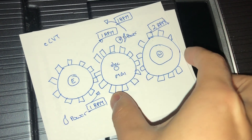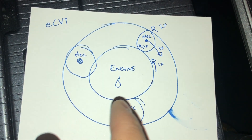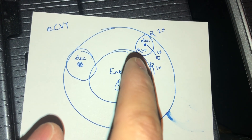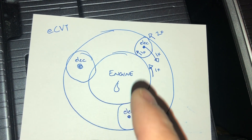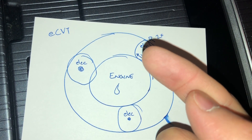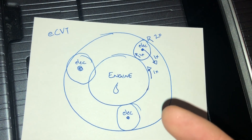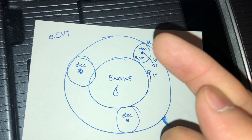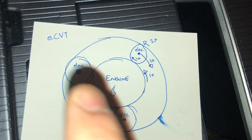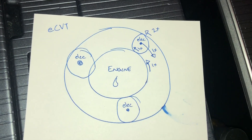This is just a depiction. What makes this possible is what's called a planetary gear, and this is how the planetary gear looks. We've got the engine here spinning counterclockwise at 1 RPM, causing this intersection to also approach at 1 RPM in the same direction. When we apply electric power, it pushes this entire gear — this axis — clockwise, which makes the intersection where the final gear touches the outer ring move at 2 RPMs. Usually in a planetary gear there are three of these, hooked up in a triangle, and the whole thing rotates as the engine rotates. That is how the eCVT works in concept.